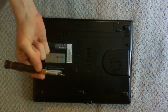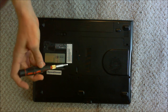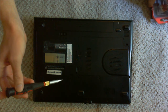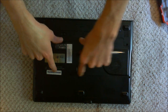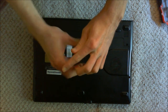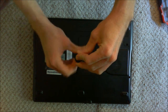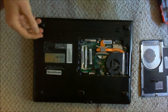You will need, generally, a Phillips screwdriver, and it needs to be kind of small for some of these screws, especially once we get down to the fan — though it doesn't usually need to be like an eyeglasses screwdriver. On these computers, this is the RAM compartment here, and conveniently it's a little large — it also houses the heatsink and fan for the CPU and IGP.